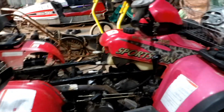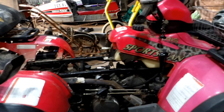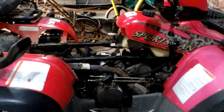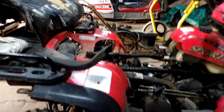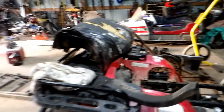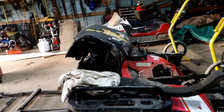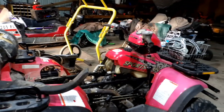Varnish in the carb — bad. Did hear it run though, guys. This thing did run. I didn't feel like turning the camera on until we get this thing bolted back on with the carb. I'll go through kind of the reassembly process of putting the carburetor back in. Fairly simple on these Sportsmans — I've been working on them a lot lately, so that tells you how reliable they are. So we're just going to get the carburetor cleaned out, get a little look inside, see what the bowl looks like, get her cleaned up, and see if she runs.